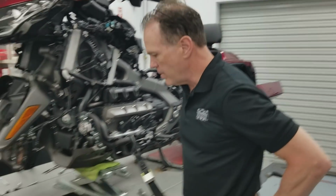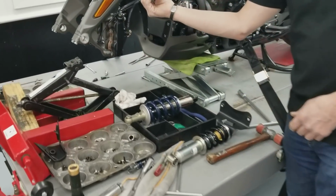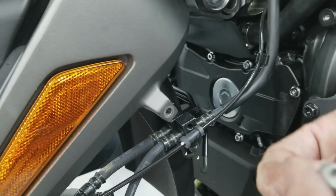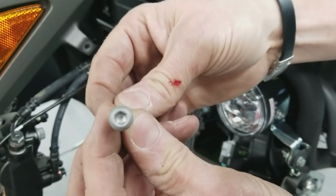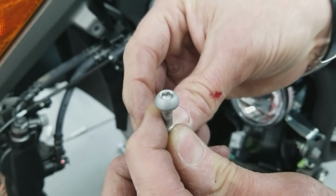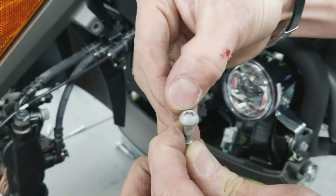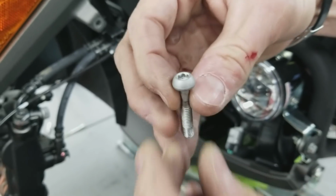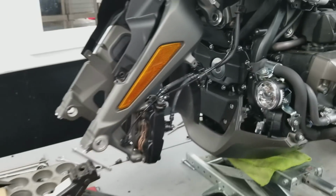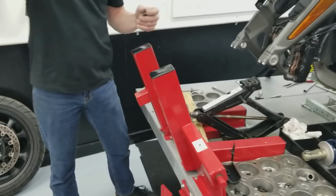And I think I did warn you about the super shallow hardware and the threat of stripping it. In particular, this is the most likely bolt to be stripped on this bike. You can probably see how shallow the depth of it is. It's probably 2 millimeters. There's nothing for your tool to engage, and the edge of it is chamfered quite dramatically. So when you put a socket in it, if it's not sharp, edged and square, let me show you, you will strip that bolt almost guaranteed.